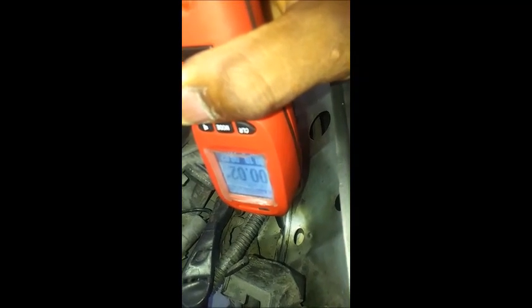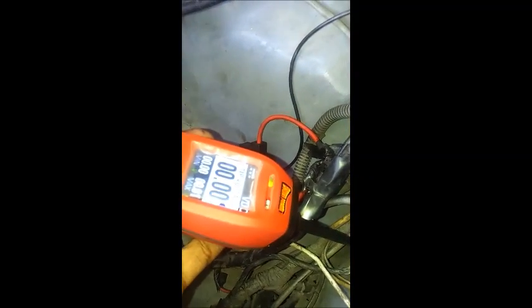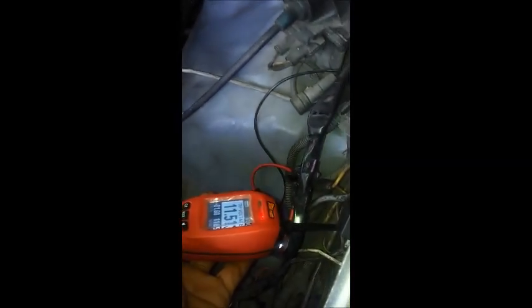Here I am on the wire that comes from the switch - apply current. The light should be on, as you can see. That shows that everything from here, through the relay, back to the fog lamps are alright. Now on the part of the relay that goes to the fog lamp - apply current here. The light should be on. That's all you do guys - easy ways to test out the circuit.